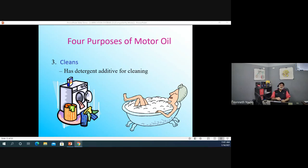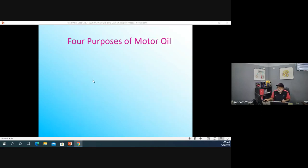And it had a lot to do with idling. She's sitting in her car and letting that thing run for hours because it did not add up to 3,000 miles or 4,000 from one oil change to the other. I want to say it was like 1,500 miles she put in. So her extended idling time made the oil change requirement different, not just mileage. Pretty cool stuff, huh? So we want to keep that oil clean.